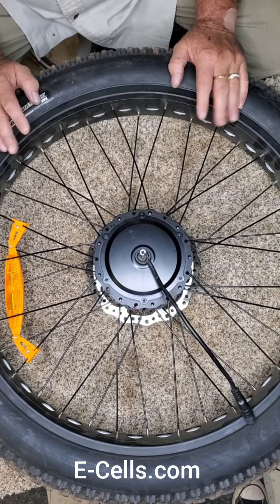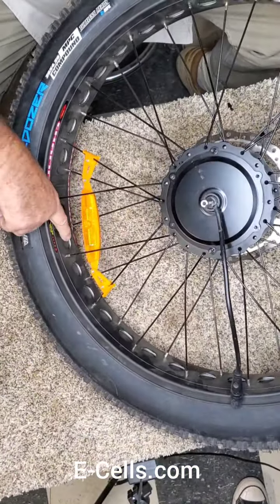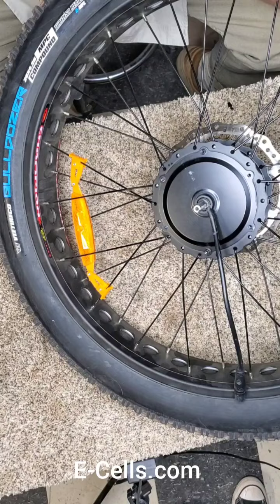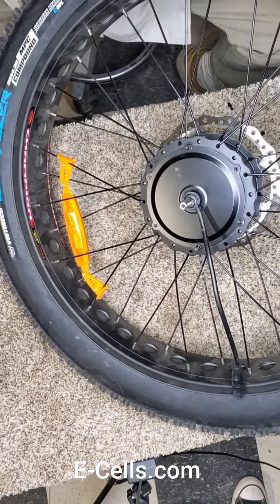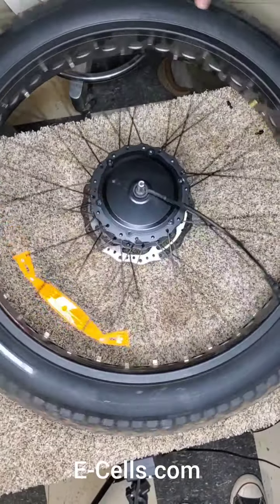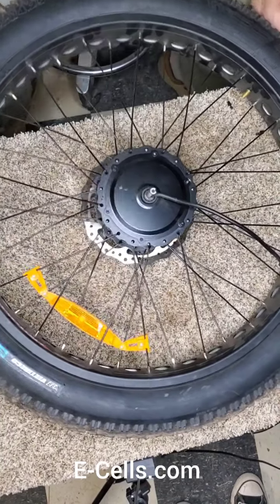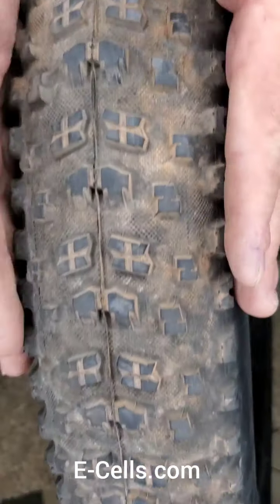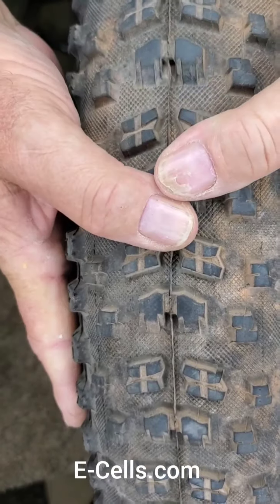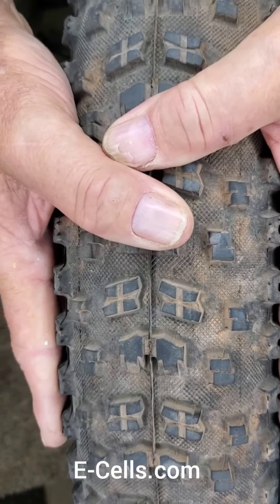Another feature about this particular bike, or all of our Super Monarch bikes, is we use a Twinwall honeycomb wheel here. It adds strength to the wheel. And so when you guys are out there running in the mountains, you don't have to worry about bending a wheel generally. And these tires are the V bulldozers. They're 4.25, but in reality, when you look at it, the tire is 5 1/4 inches wide. When this tire is down to 10 pounds, it actually lays a 6-inch tread pattern on the ground.